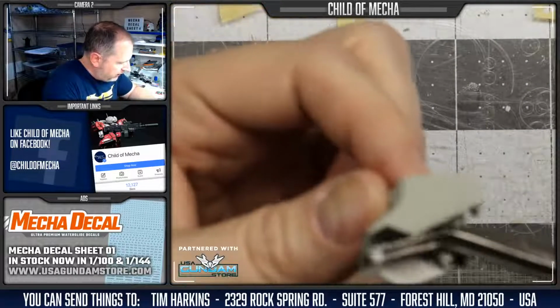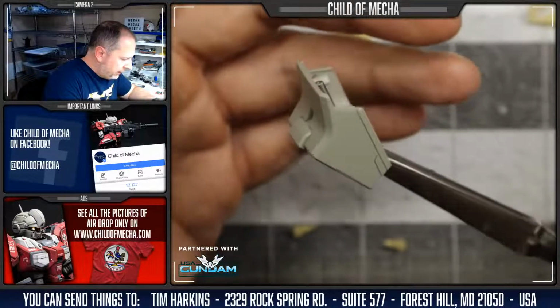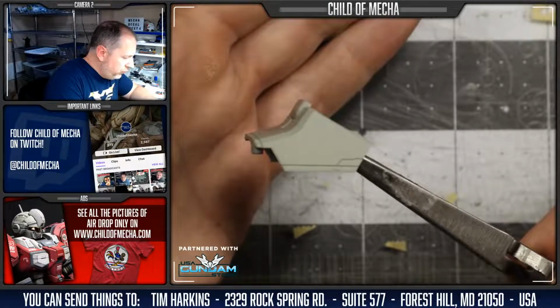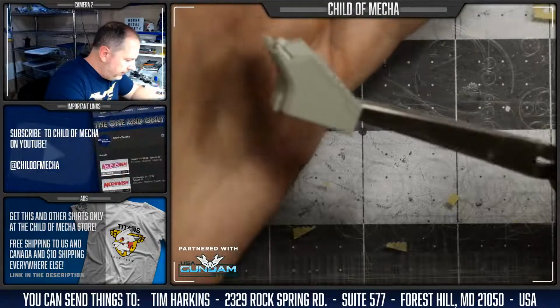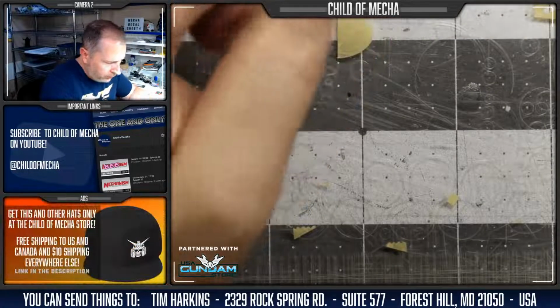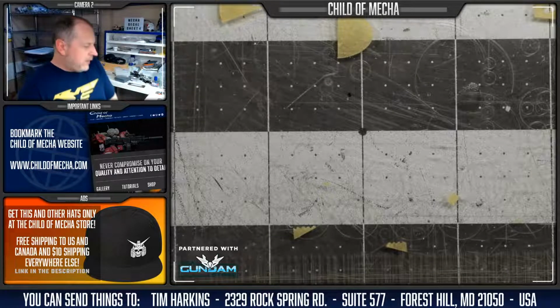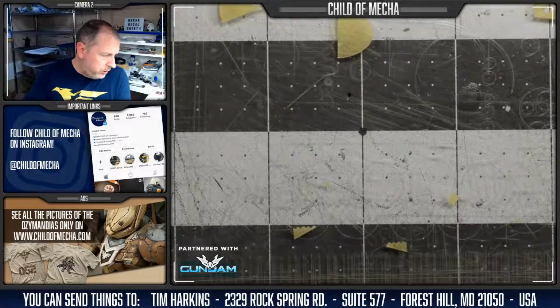This gray was particularly cumbersome in terms of getting coverage because it was so close to the primer color, right? So you really had to look and kind of pull back from the spray booth and hold it under different light to make sure you got the proper coverage. So there's a point, I guess, that I just missed, and then I'll have to go back and repaint. Not a big deal at all. So I'm gonna hold off on masking until I know all these parts are completely good.